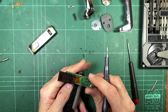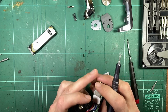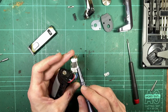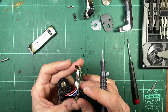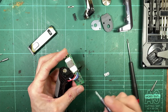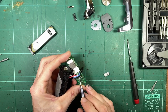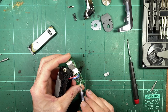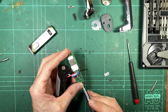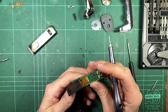And we're seeing all the normal stuff, really. No surprises for the board itself. Microcontroller there. Power section, big inductor, which looks about right for a 100 watt board. Then MOSFETs for the switching, for the voltage conversion. So it's your power output section, and then you'll have some other ancillary stuff like charge circuit, probably that guy. Inductor for the charge circuit, probably another switch mode supply for the screen and microcontroller voltage. And, you know, just pretty standard stuff there, nothing too tricky.